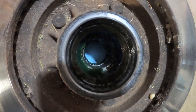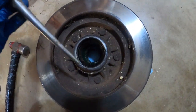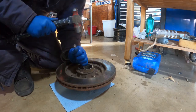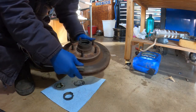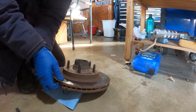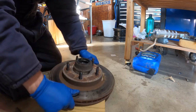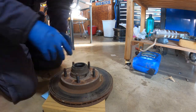To get the races out, you've got to find the lip of the old one — there it is — and punch them out. So I get to use one of my favorite tools: hammer and a punch. I just take the punch, get it right on the edge, and knock it out. The front one is right on the edge — we can just pull it right out. Flip it over for the back one. I prop it up on some blocks — convenient that I had some right there — and bingo, the back race is out.